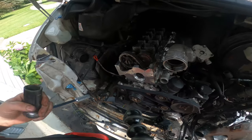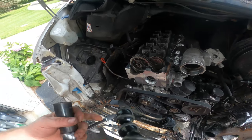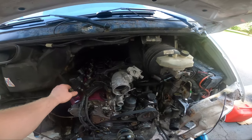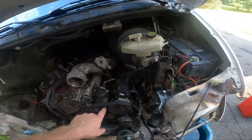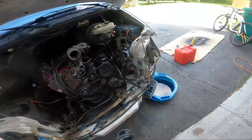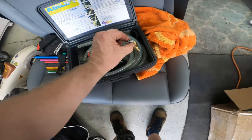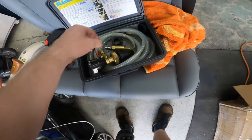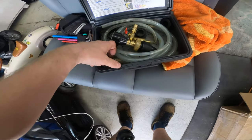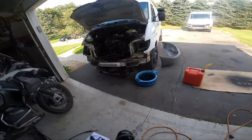I gotta take off in about an hour. I should be able to put the valve cover on — I can set it on there to keep stuff out of the way. Got a lot of things torqued down. I still gotta tighten my fuel lines and hook them up. At this point it's one step at a time, work my way around the engine. I'll hook up the turbo, put the front clip on. A guy at work let me borrow his filling thing — it's got different fittings to go on your radiator. You essentially pull a massive vacuum on the whole system, it'll collapse all the hoses and everything, then you jam the filling end into a bucket of coolant and it's supposed to suck it all in with almost no air pockets.